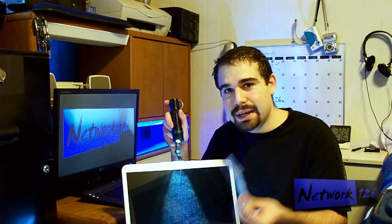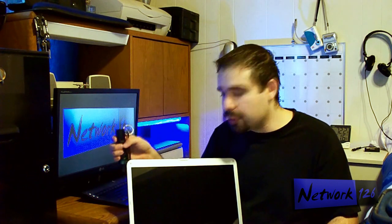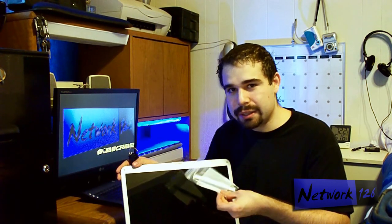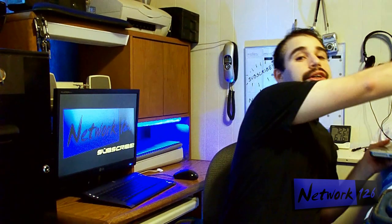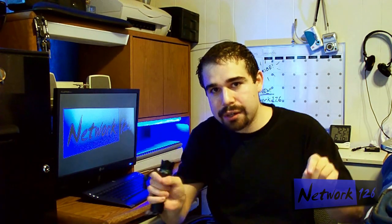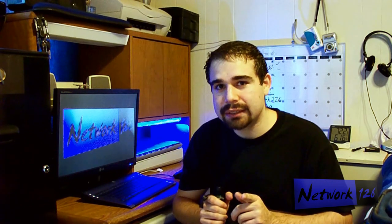This part sends power to the light — it's pretty simple, kind of like a phone charger power brick. I don't know why these things fail. Every once in a while the lights themselves in the screens will fail, but more than likely it's the inverter board, and these are a lot cheaper. I got this on eBay for about $15, but it depends on the brand and model. Sometimes you can get these for $5 or $6, with a couple bucks shipping or sometimes shipping is free. So I'm going to show you guys how to replace that — it's not very difficult. You just take apart a few little screws around the edges of the screen bezel, the plastic layers peel apart, and you just replace that little part. Stay tuned.